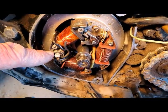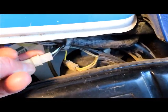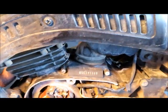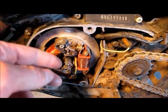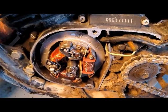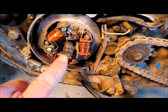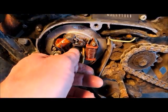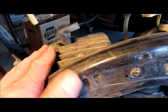I got it all put back together and checked the resistance at the connector — black wire to ground. Perfect, 1.3. Awesome, right where we want to be. I put the flywheel back on, watched the points per what the manual says, and got the points set just right. Then I stuck an electric drill on the nut with the flywheel on it, spun it counterclockwise, watched for spark — and I got killer spark, just zap zap zap, working great.